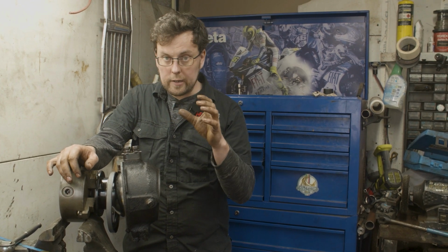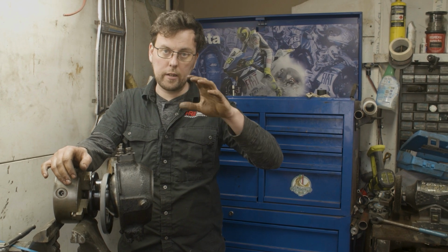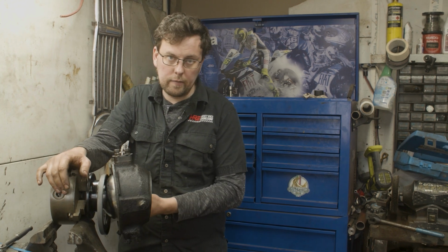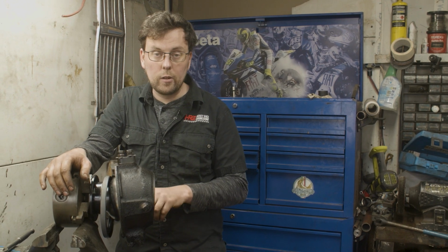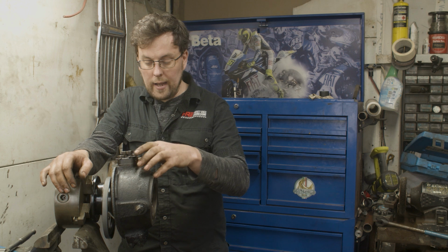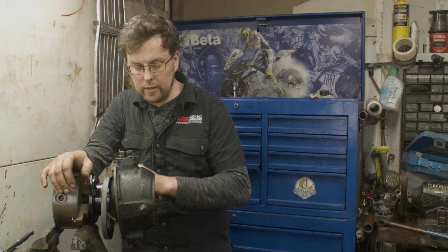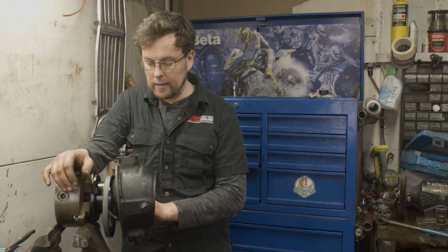You're probably better off getting it just at that point where it's in the middle. It's going to loosen off a small bit with a bit of driving, and it'll come to that sweet spot. It's something that we will check in 5,000 or 6,000 miles' time. At the end of the year we'll do a full service. We'll whip off the 2 links and check these to make sure, and we'll readjust that shim if need be. It's an easy thing to do in the car. It's 4 bolts, and take off the steering arm, and then that can be done.